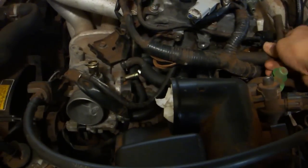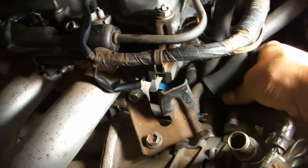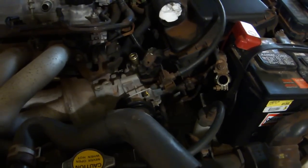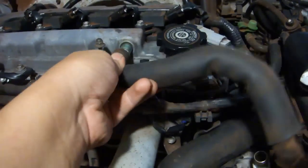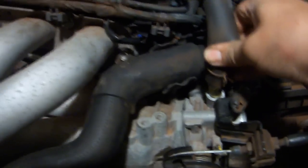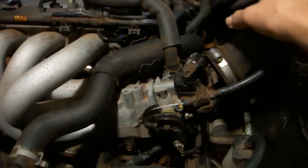Thread this PCV hose down through here, connect the upper portion here. Reclamp it. Reattach the other end of it here and reclamp it. I personally think this is a much more logical time to install the upper radiator hose. Slide this into place and reconnect the hose and reattach the hose clamp. I think it's easiest to get to the clamp from this angle. Now we can attach and reclamp the upper PCV hose. Remove the wadding and reinstall the intake hose. Retighten the 2 screw clamps.